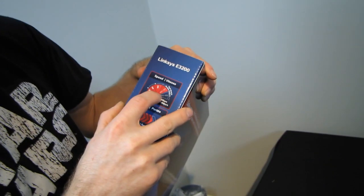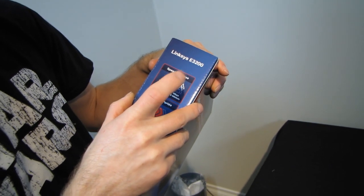I made a mistake — this is actually a dual band concurrent router. So the scenario where you want to get away from interference is still true, but also the scenario where you want to use both bands to send and receive data at the same time for a performance boost does apply to this router.